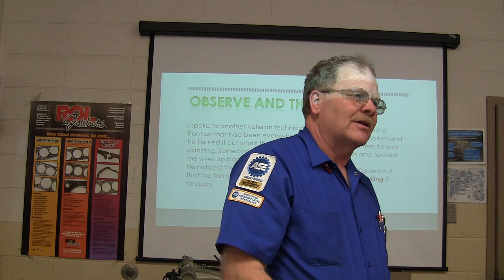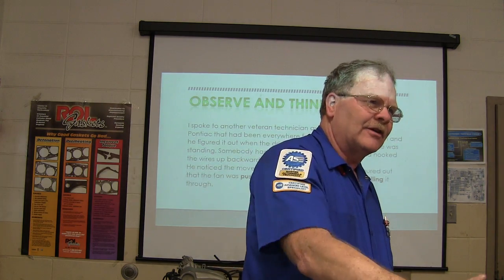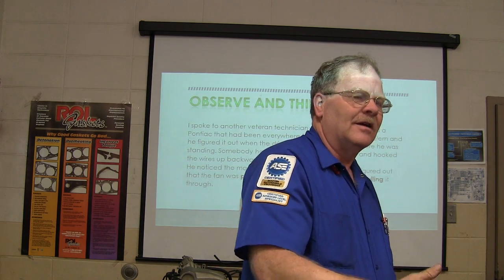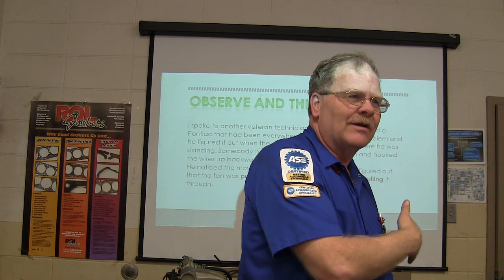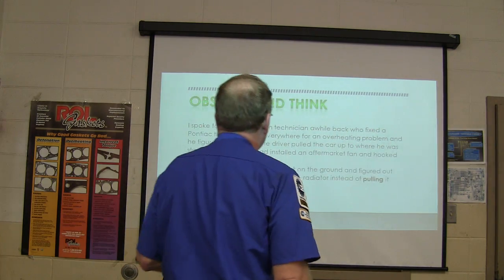You see the things fighting the wind when you're going down the road. You know what I mean? So you got to make sure that, if you take a piece of newspaper and put it up against the radiator, it should suck it in, or up against even a condenser. But if you put that newspaper against it and it blows it away from it, somebody's put it on there and wired it up backwards because they feel like a fan's a fan, right?